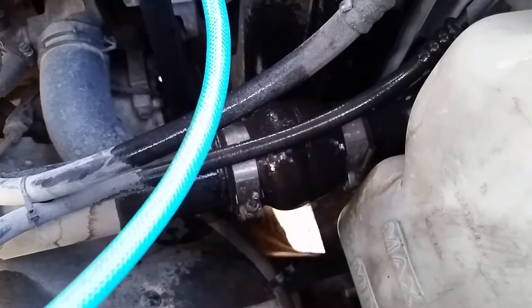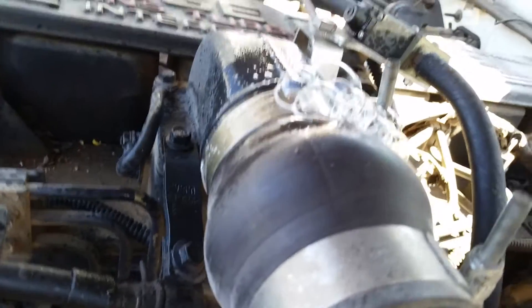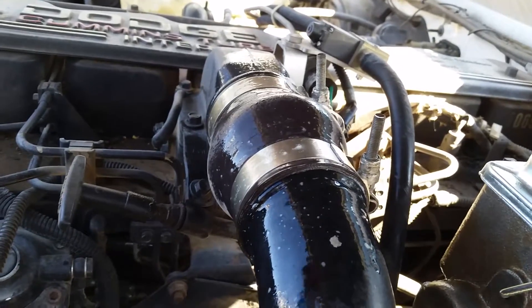Looking at that gauge — it's at the bottom end of its range, only about 10 psi, and that's just one coupler. I don't think this other one leaked. I wish that hissing didn't happen because I'd really like to check out the intercooler. That one is okay, but that coupler is shot. It's leaking at only 10 psi, and where I live is 3,500 feet altitude. The truck's mileage is only 15, 16, 17 mpg no matter how slow I drove.